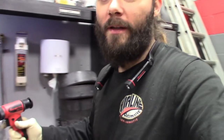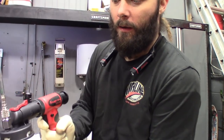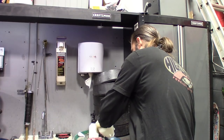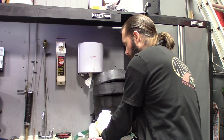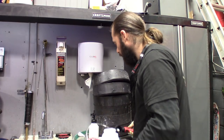So I just wrapped up the other side. You basically just want to alternate back and forth between the two until you get a decent flow, then hop in there and check your pedal. It took about two or three times. Afterwards, obviously empty the brake fluid out into your waste bucket — whatever you've got left in there. It was good clean brake fluid too, it wasn't dark, so I know everything flowed through there.